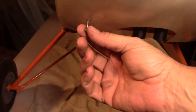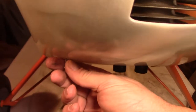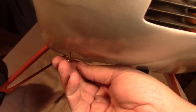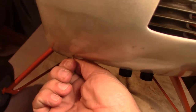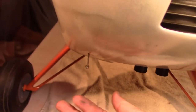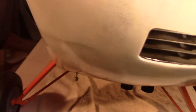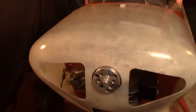I couldn't find my little grommets, so right now it's just sitting here. Remember, this is in the run position. You pull it down and that's got the choke on. So once it starts and it's popping off and you need to take the choke off, you just put it back up and then go ahead and start spinning the prop again.